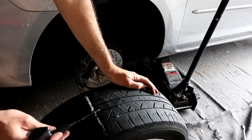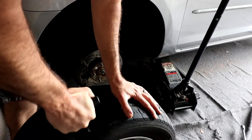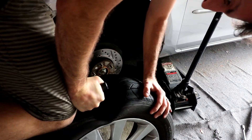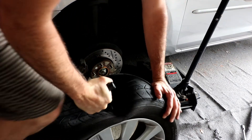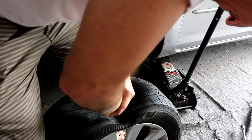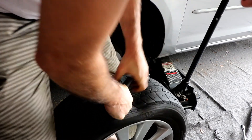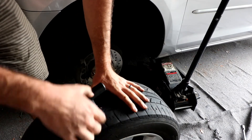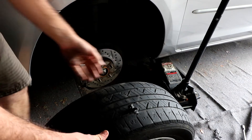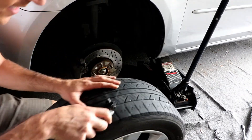Now I'm going to go straight in — and this is where it gets hard. You need to use a little extra leverage. Almost got it in. There we go, it's going in now. Get it in most of the way — you don't want to put it all the way in. Then pull straight up; it's such a tight fit that the tool should pull out and leave the patch behind. Now it's got some of the patch going inside the tire and some going out.